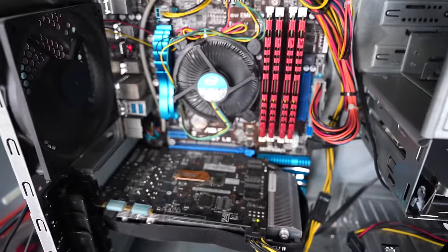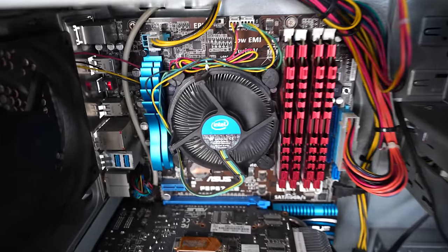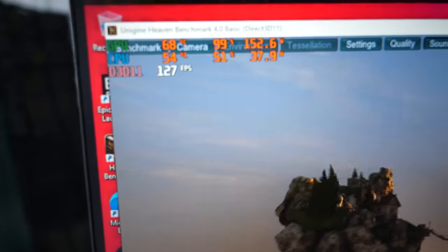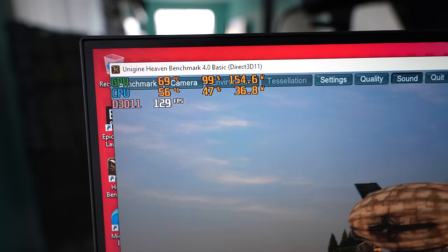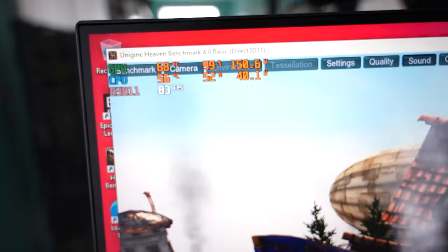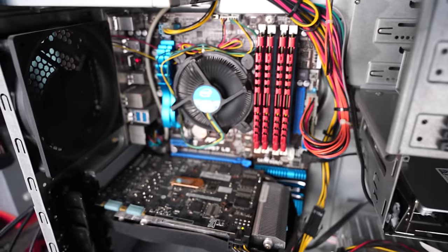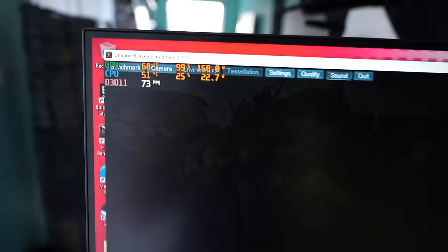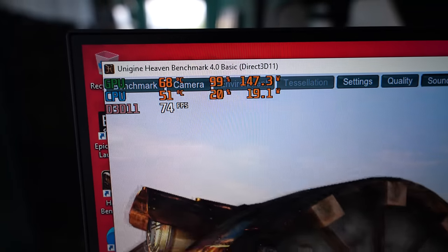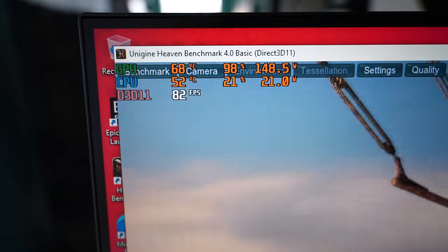So perhaps the settings were pretty bad by default in the BIOS. I mean, it is an i5-2500, which I haven't seen a whole lot of, but maybe the CPU cooler in one of the corners wasn't on properly. Either way, that's a tremendously better result than we were getting before. Just miles better. So we did a 50 millivolt undervolt, but we also took the speeds down to 3.4 gigahertz from 3.7. So essentially it's an i5-2400 now, but this is so much better because once I've cleaned all this up, I can be confident I can sell this without having any crashes.